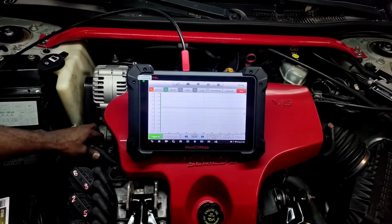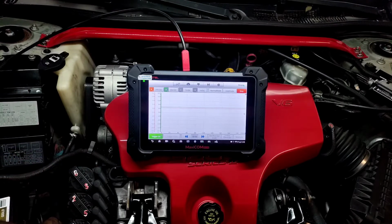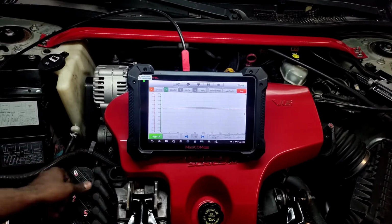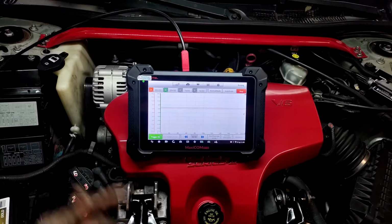I want to see that. Just moving things around here. Want to move the connector around, coil towers. Nothing has changed. All right, let's look at the signals. And what I'm going to do next, after we check the signals and do some more wire movement, is see if there are any consistencies with the waveforms, and then we'll try putting bias voltage to see what happens.